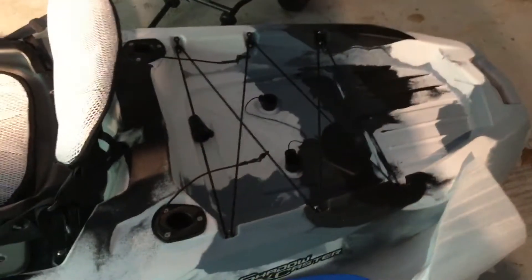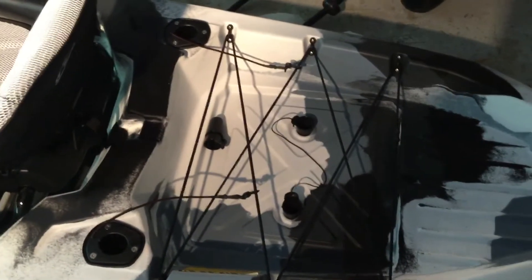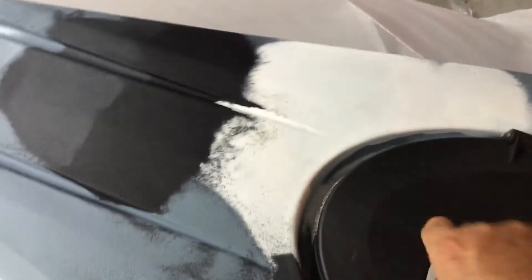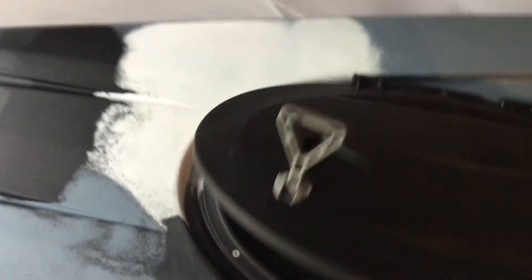As you can see, there are a couple of scupper plugs. Those are Hobie scuppers — a little bit pricier than some of the others, but I like the nice black, simple look. The front compartment — how watertight it will really be remains to be seen. I do plan on taking all the various screws out and putting a little marine sealant on each penetrating screw and sealing around it a little better.